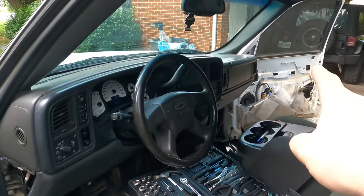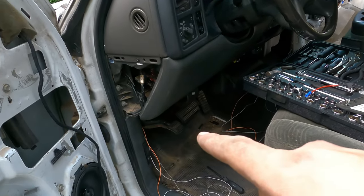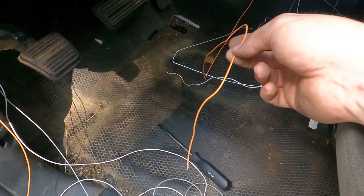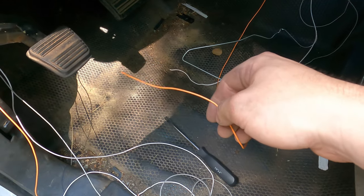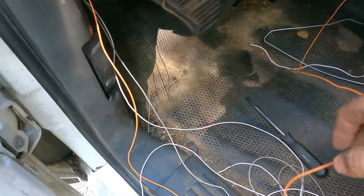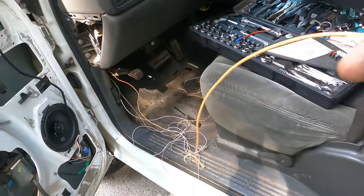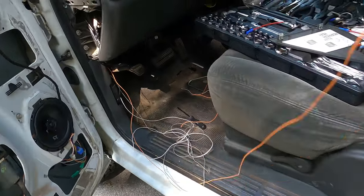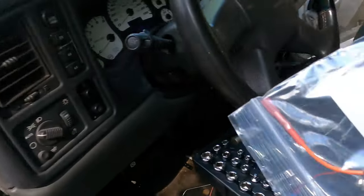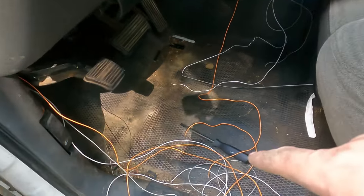I went ahead and put the passenger side on so I got all that wiring ran through. Now what I'm thinking — because this orange wire isn't quite long enough to go through the firewall up to the fuse box — I'm going to splice it into the driver's side first, run it through to the engine bay, and then figure out a good point to splice. All the other wires are plenty long enough. I'll show you how to wire in this other module too — it controls those little pods on the mirrors.